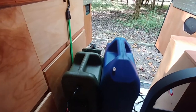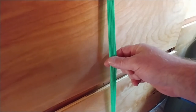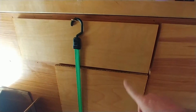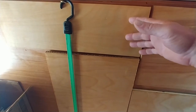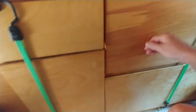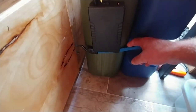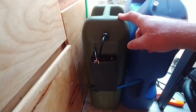I'm using flat bungee straps — see how these are flat instead of round — to hold things closed. Even though these are soft-close drawers and soft-close door hinges, when they have weight in them they'll try to open up on you while driving. So I basically put two hooks, one at the top and one at the bottom, and run these flat straps to keep them shut. I did the same thing to hold the tanks so they weren't moving around back here.